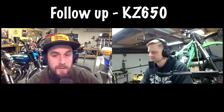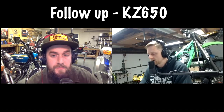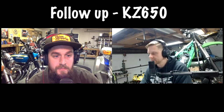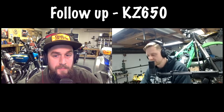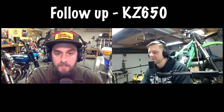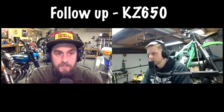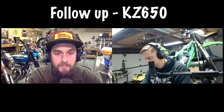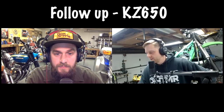Okay. Since it's a 70s bike, it probably wasn't lean from the get go. I've had some CB550s, they actually want a leaner pilot jet. But this is a fuel screw. It's probably going to want one size larger, at least on the fuel screw. Or wait, he says air mixture screw. Okay. I don't know, but the answer will be in the air screw setting. If you tune this guy and you're at 1.5 out, you're good. Wait, he's saying 2 turns out. I'm all over the place here. Sorry. No, you're fine, man. Okay, so he's 2 turns out. So he's trying to lean it out.